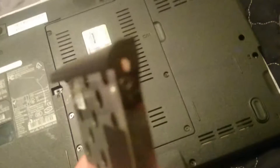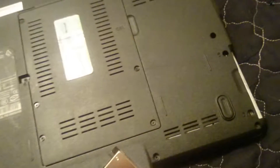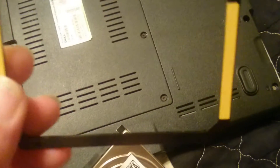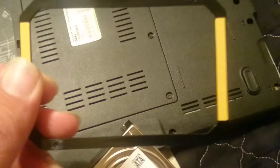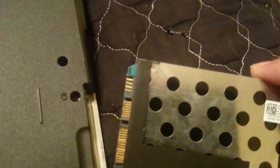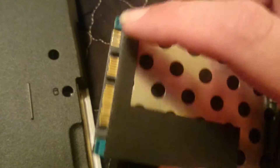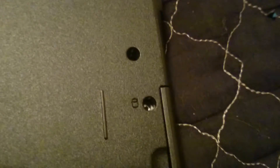I've got my old hard drive back in — screws in there, screws in there. Here's a pointer: if you're replacing a hard drive and your new hard drive is thinner than the old one, you will need this little plastic bracket. Since I'm going in the other direction and the old drive is thick, I don't need it. Just slide it in — and that's why you need that bracket: without it, the pins won't connect and the computer will not recognize the hard drive. Slide it back in and put in those itty-bitty screws.